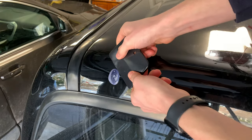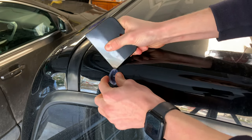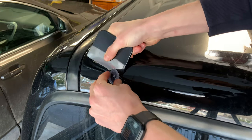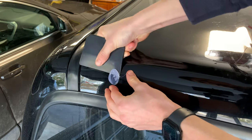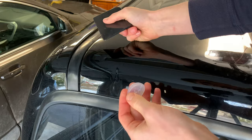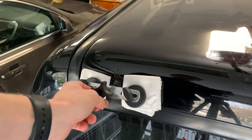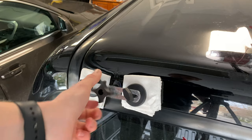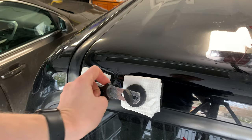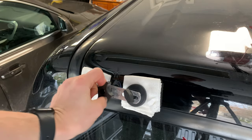As you can see, in the process of pulling that dent out, the hot glue stuck to the truck — and that's actually a really good thing because it means it's pulling the dent out. You just got to use the scraper that the kit came with to peel the glue back and keep going. You just got to keep pulling on that dent until it comes out. It took me about an hour of doing different pulls in different areas on the dent to really try to get it out, and it comes out great in the end.